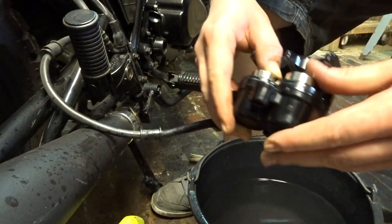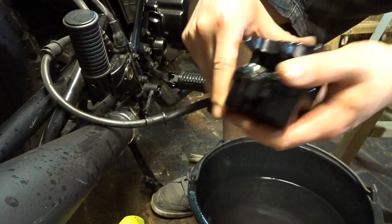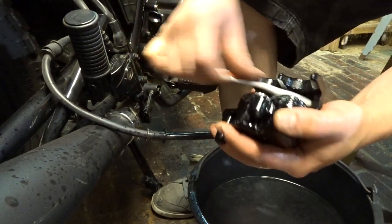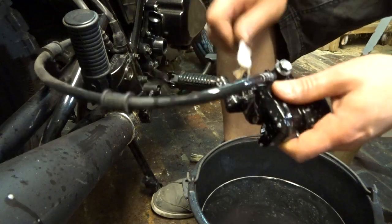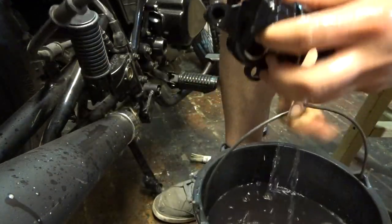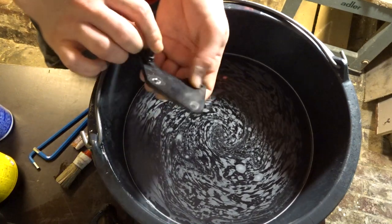After cleaning the piston sides, push them back — it's going to take some force but you should be able to do it. Now clean this surface again: apply some wheel cleaner and use the toothbrush, get it a little bit wet and clean all the sides. Hit the outside some more — since the brake caliper is off, why not clean it all the way. Rinse it off and let it hang to dry.